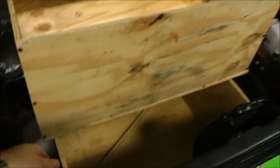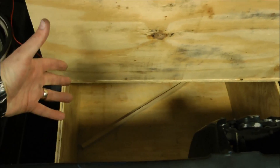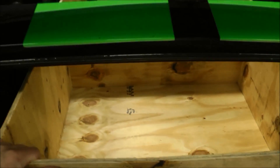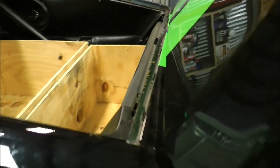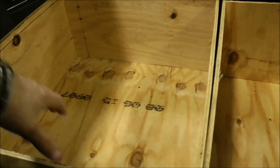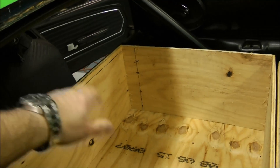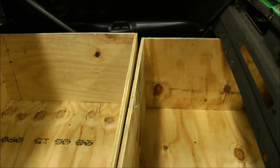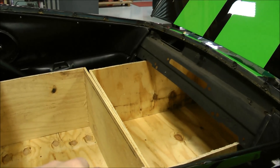This bottom box will of course be sealed and have a lid — that's the pack of batteries raised and lowered from underneath, the way the old pack was. This is the top cartridge, and we'll be able to position it either toward the rear or toward the front. More toward the front is better for putting weight above and forward of the axles. The third module will go here and can be positioned as far forward as the strap bar on the roll bar. We'll put them on a sliding rail system and have cooling inside. The bottom line is, this will absolutely work.